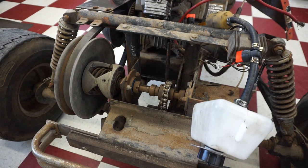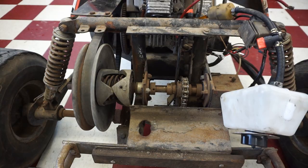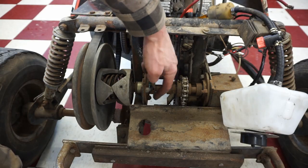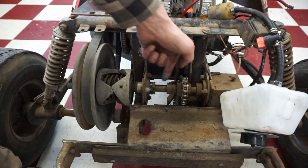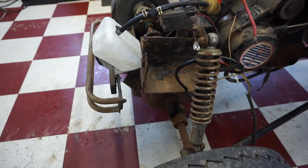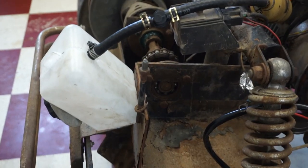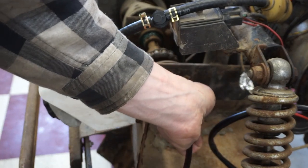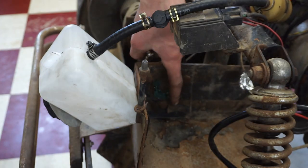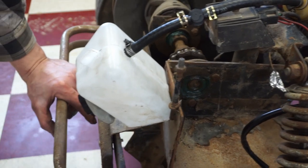All right, we're gonna take a grease gun and go through all the bearings and everything and just try to apply as much grease as we can to the bearings. This thing's been sitting for a long time. Try to apply some grease around the bearings and maybe it'll pack in there eventually. Let's see anything that spins here. This bearing, unfortunately, looks like it's a little bit rough on the outside here. And pack that one full. Looks like they had tape over that at one point.